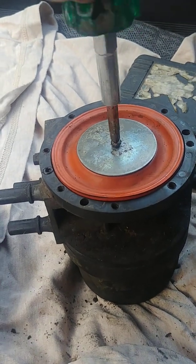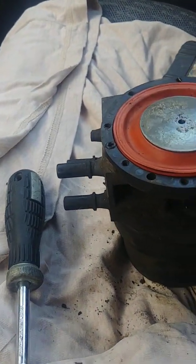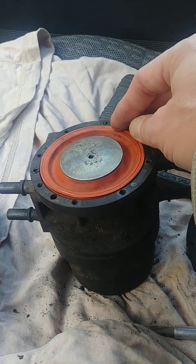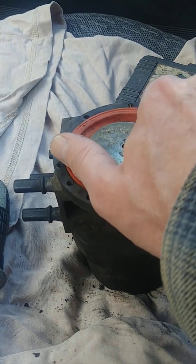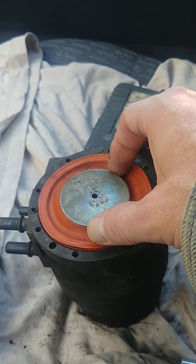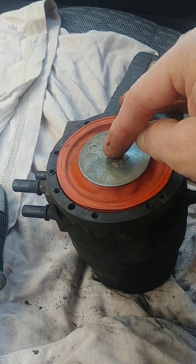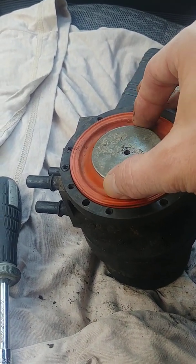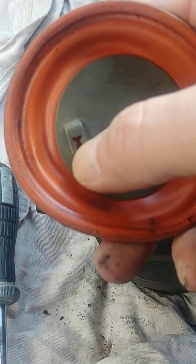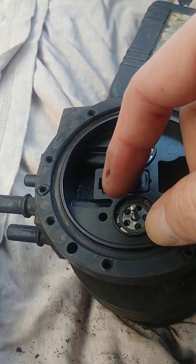The way this works is if you remove the center screw — it doesn't use electricity, it uses hydraulic pressure. The pressure that the fuel pump pushes through it actually moves this and selects the tank. After you remove the screw out of the center, this piece twist locks out of two little tangs, and that is what you have inside. There's your twist lock area that twist locks onto those pistons.